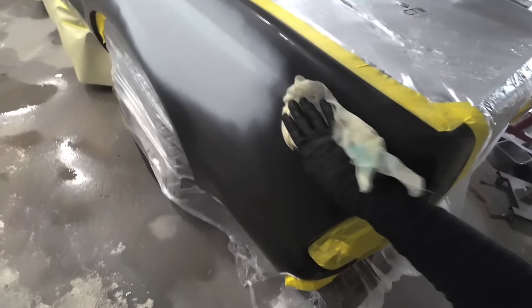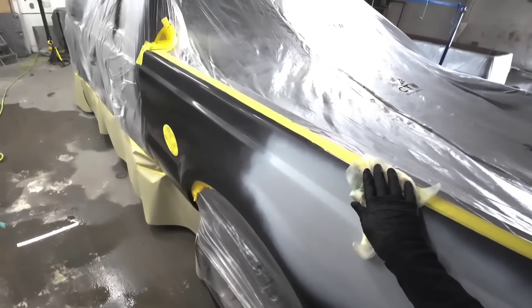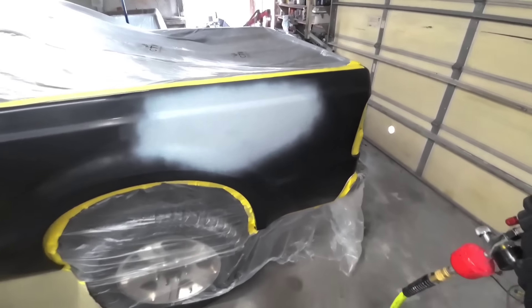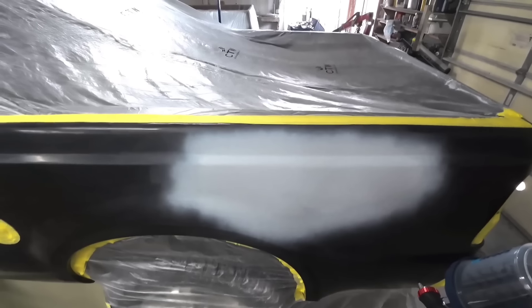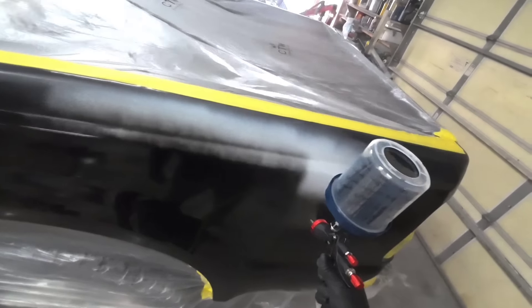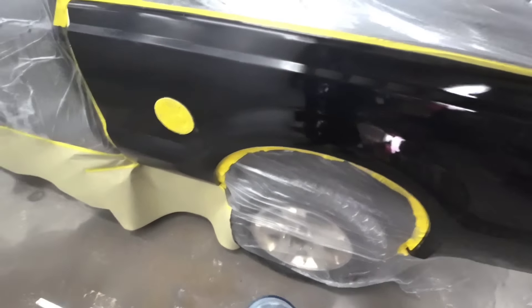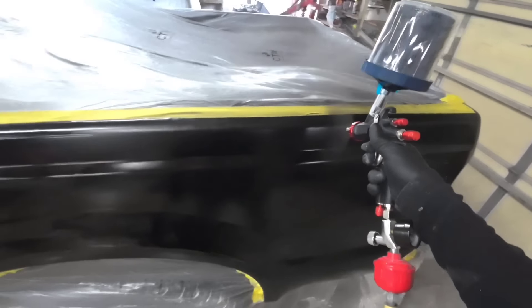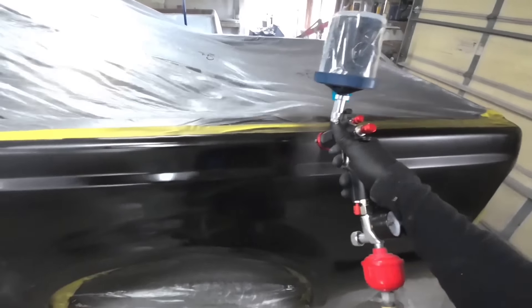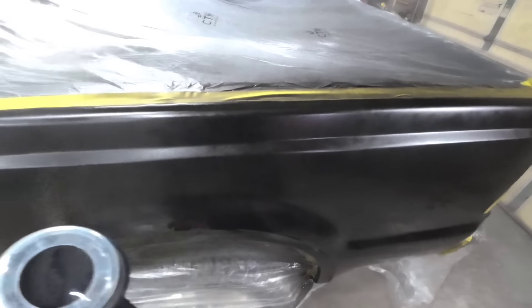This is dry now — we've let it set up enough. I'm wiping off some dust here. If I were to spray over it, it would probably be fine, but I like to start with a nice clean surface. We're going to put one coat on, let it flash off for 10 minutes, and then apply a second coat. I'm going to overlap 80% as I make my passes. That's the first coat. After 15 minutes we let that paint flash off and we're ready for our second coat of base. Don't try to cover your sealer all in one coat — let it flash off for about 15 minutes. I'm also going to apply a third, lighter coat and blend it out into the rest of the bedside. The only thing I do to apply a lighter coat is just increase my distance from the panel a little bit.